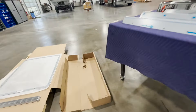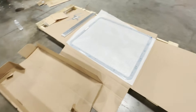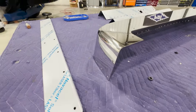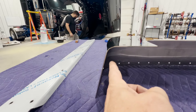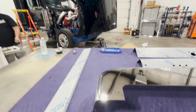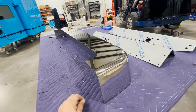Here's what we got going on. We've got this pretty awesome grill, a backing plate over here — we're gonna paint the backside of that blue to match the truck, or maybe black, not sure yet. And then this new stainless grill surround. There's a big difference in this surround versus what you'd have on a 389. The 389 is not gonna come out with this angle — it's more straight down. You've got all four pieces for your grill surround, which we'll start bolting in and replacing the hucks as we go. Things should look pretty freaking cool when it's done.